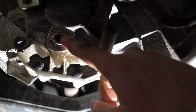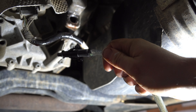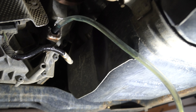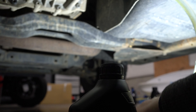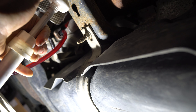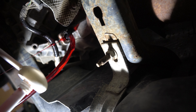Wipe it up and when you tighten the drain plug the sealant will spread over all the threads. One hand tight, then snug it with the ratchet. Grab the pump, sink the tip into the fill hole — just squeeze the black tip in until it locks. Slide your bottle onto the other end and start pumping the handle: it sucks from the bottle and pushes into the transfer case. Keep filling until fluid spews out the hole — nice and bright red. Then slip out the tip and put thread sealant on and seal it up.